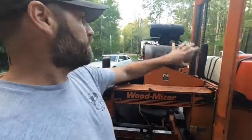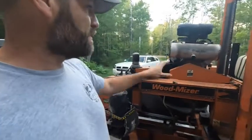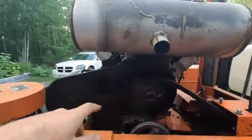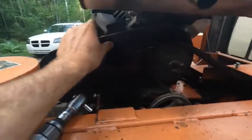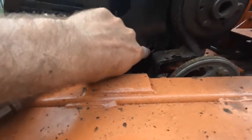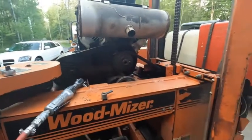So not a direct how-to, but I don't work on Wood-Mizers every day. We've got to remove some of this to get to the engine itself to start this procedure — just pulling shrouds off and all that fun stuff. Already in our first shroud and I've identified a few more problems, which is typical. These things see a lot of wear and vibration. That's the alternator guard for the alternator belt — it's basically riding on the main belt itself because the bolt tab here broke off and either vibrated loose or pulled through. So it's just riding on the belt, something else we're going to have to fix.